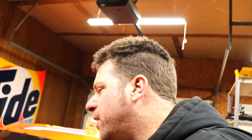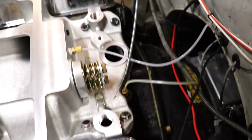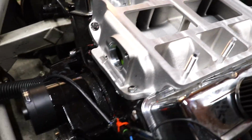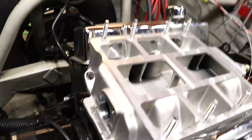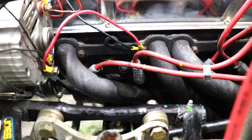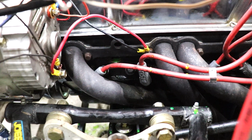So here's to making dumb mistakes. I don't know if anyone can relate. I'm gonna move the coolant sensor because there are these two holes back here, but the coolant doesn't really flow down where those holes are. And the place the coolant sensor was before was right up in the front of the intake, but there is no place to put the coolant sensor in front of the intake. So there is a spot right down in the side of the block in between the 1 and 3 cylinders. And there was already a sensor in there, so I was like, oh, just pull that sensor out, no big deal. I should have been thinking, that was really dumb of me.